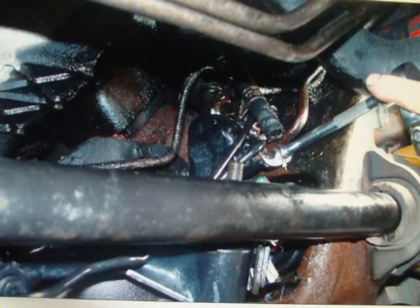And this is where we use the crowfoot wrench. What a crowfoot is, you have your ratchet, your extension, and this flat little end of a wrench just slides on the end of your socket, and you can only give it quarter turns or half turns. And you turn it quarter turn, lift it off, put it on, quarter turn, because you're coming in from on top. So you can see the ratchet's pointing down, and this here is flat on the bottom. So that's a really good little wrench to have to get at this pressure line. I'll show you a picture of this wrench later by itself. So undo your pressure line and your return line on your steering rack.